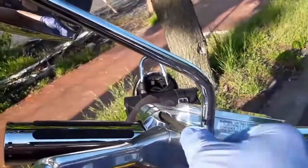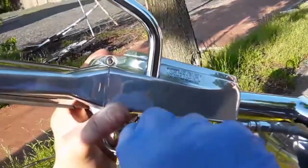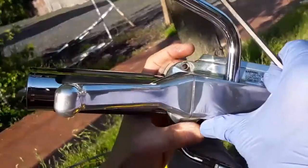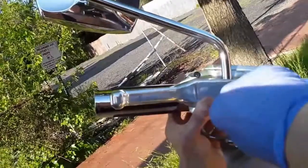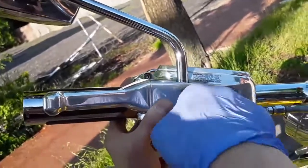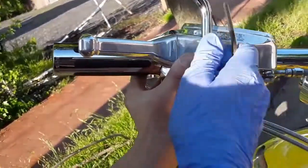If you take this completely apart and take the cables off of the hinges, there are ways to get it better lubed up, but because I'm doing this so frequently, I'm pretty confident that I'm getting all that lube in there. I personally would rather lube more frequently and not have to take the entire thing apart, rather than making it a big project once in a blue moon. So once you tighten these up, your cables have been lubed and you're good to go, and that's how you lube your cables on your bike. Thanks for watching.